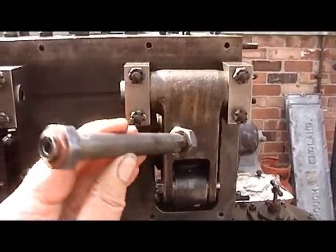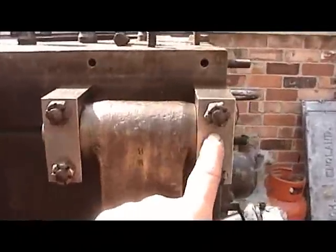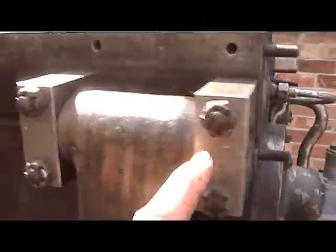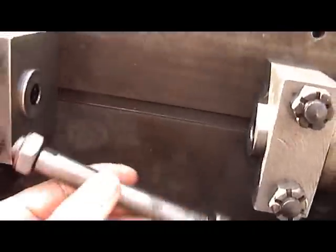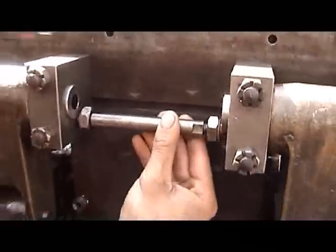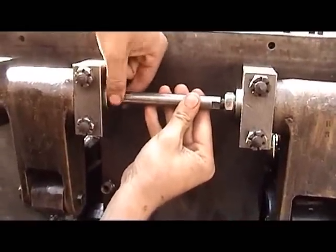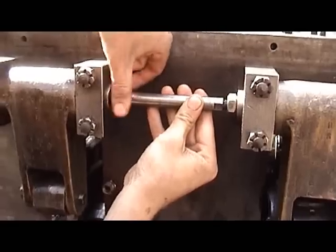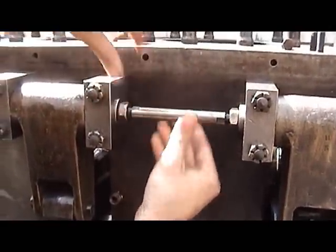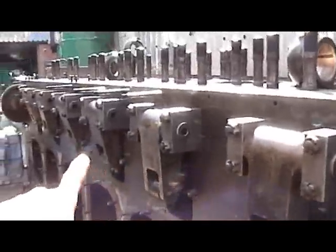This is a rather clever oil jumper pipe that goes from lever to lever. The oil is fed into this one via this pipework here through the drillings, goes through the shaft — the drilled hollow shaft — and then with the aid of this jumper pipe, transfers the oil to the next one and all the way along the engine when we fit them.